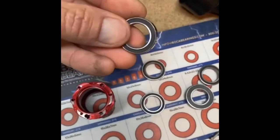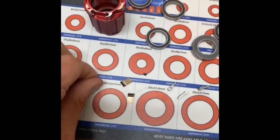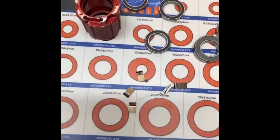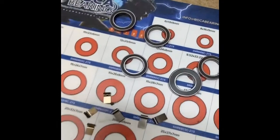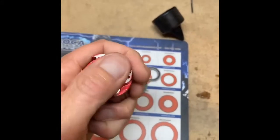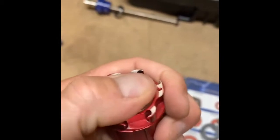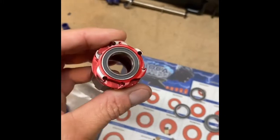These are ceramic bearings — you can get decent bearings for about $10–$15 a pop. We'll rebuild this spring assembly packed with grease. The trick I'm using to make it easier to press the bearing in is heating up the hub a little bit with a heat gun and putting a little bit of grease on the outside of the bearing. By heating the hub up, I didn't even have to use my special tool — it just pressed in nice and even by hand.